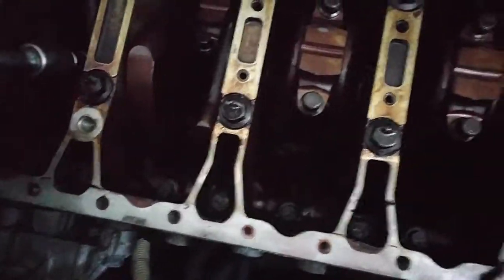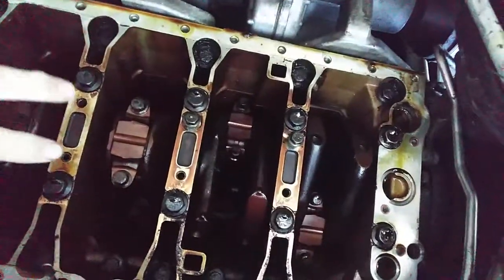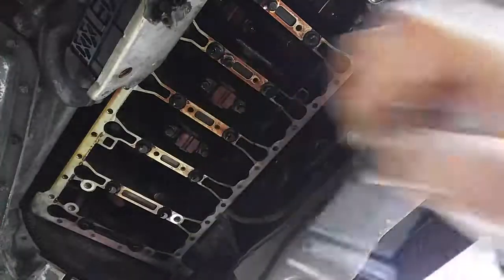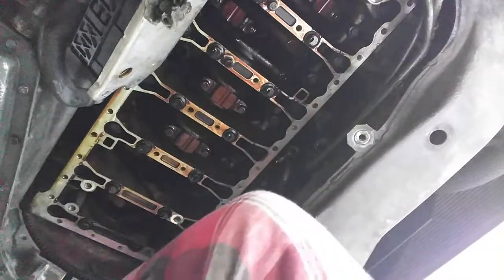Under the Volvo looking at the bottom end, I'm taking off the rod caps. The main crank caps are this whole bottom piece — it's a different setup than I've seen before with other cars, but it does the same thing: it holds the crank in place, and probably does a better job with less or no warping. I've loosened these already.